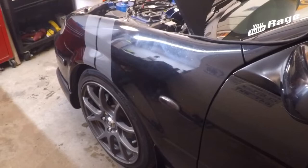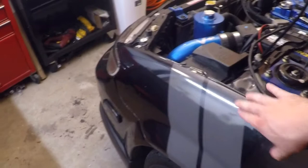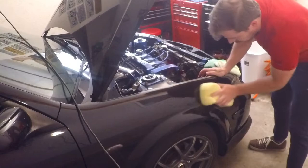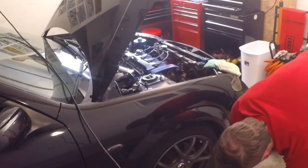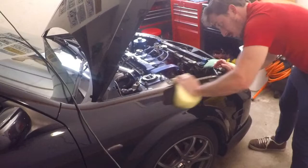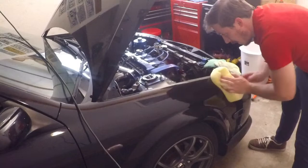This time I promise I will show folding it back, cutting the backing off, sticking it, and rolling out the air bubbles so I won't have to cut that away again. Just like we did the other side, we're going to wash this side of the car. The reason for Dawn, in case anybody was curious — Dawn will cut grease, wax, etc., so if you wax your car a lot it'll cut most of that off and the vinyl will stick better.